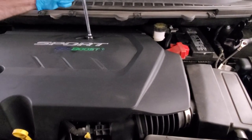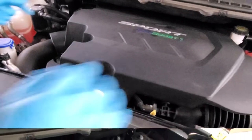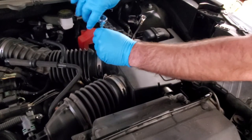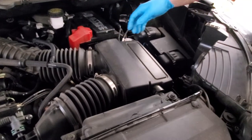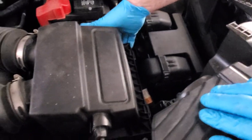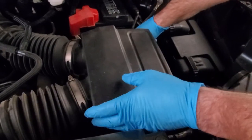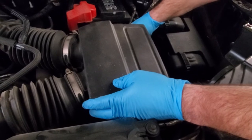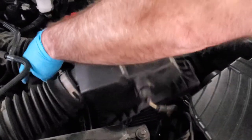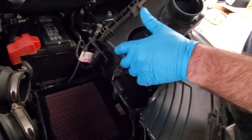Going to go ahead and get the bolts in the middle of the engine cover. We're going to loosen up the clamps on the intake boots — this is a 9/32 socket. Next, go ahead and undo the clamps on the intake box cover and you should be able to pop it up. There are two ears down in receptacles in the lower box that attach to the upper box, so just pick up on the outside of it and slide it out. Then we're going to pull our boots off and take the whole upper box and set it off to the side.